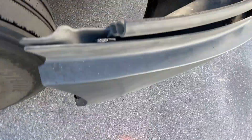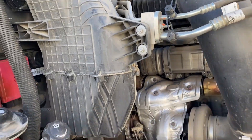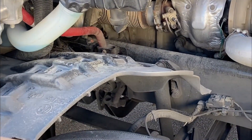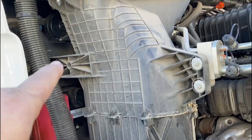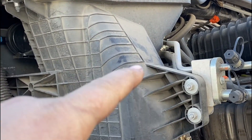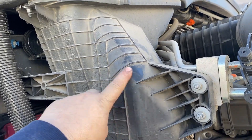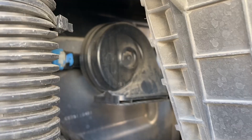On the newer model, the horn is on the passenger side. It's right there, right below your washer bottle. If you go by your tire and go up the passenger side, there's a fuse box and power distribution center. The horn is right behind the intake for your outside cab air — you can see it right in there.